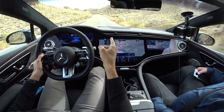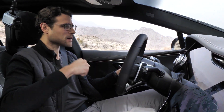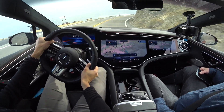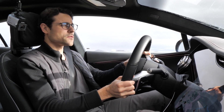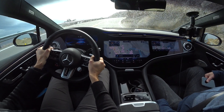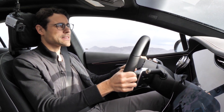As for the technology setup: one electric motor in the front, one in the rear. What's the difference from the normal all-wheel drive EQS 580? In the EQS AMG, the rear electric motor has some hardware modifications — a couple more windings around the electric motor and it's a little wider. Little hardware changes, but the same base electric motor, changes only to the rear one. In general, the rear electric motor is stronger than the front, giving us a rear-wheel bias — a good thing for more agile driving fun. With the dual electric motor setup, we can bring all the power to the ground. Really feels amazing, and at the same time very comfortable.